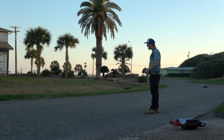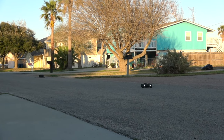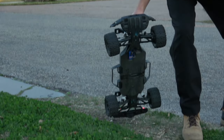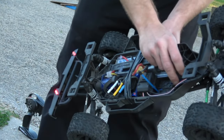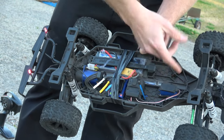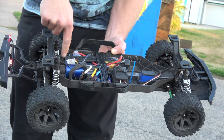Do you hear that? We finally broke it. Sounds like the spur gear. So we finally broke this thing — wow, it took a lot. Looks like the stock servo just broke at the mounts — little ears busted off. So I had to replace the servo. And it sounds like the pinion gear fell off, or I chewed up the spur gear.